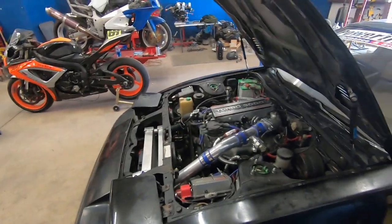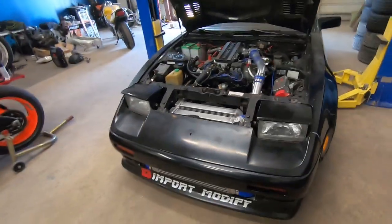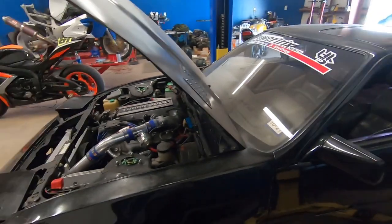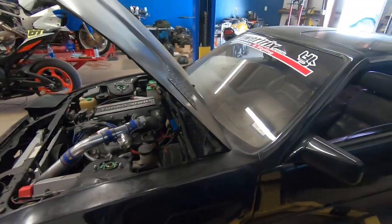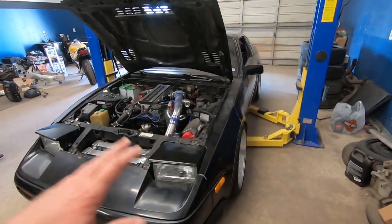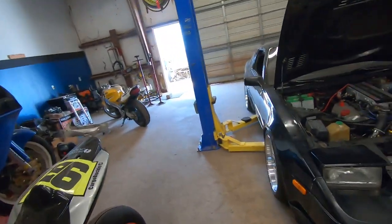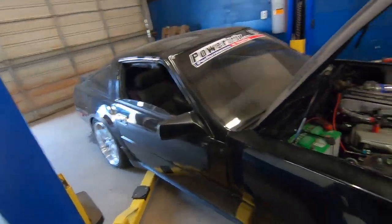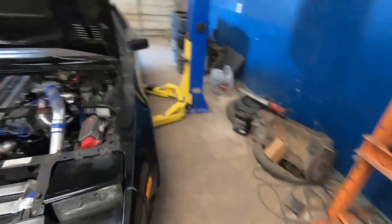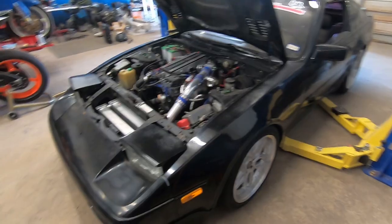I'm going to start doing research to get a game plan on wiring in the Megasquirt, and once that Megasquirt is in, it's going to be fun — I can't wait. Shortly after that I'll get the Heim joint kit in for the suspension. I just need to put some money aside to invest in that kit and weld in the full Heim joint setup. That's going to take care of a lot of the flex issues in the suspension since it'll be Heim joint solid. The downside is you sacrifice comfort on the street, but this car is a sport project, a play toy — I'll sacrifice the feel for the experience any day.